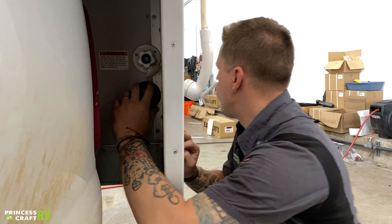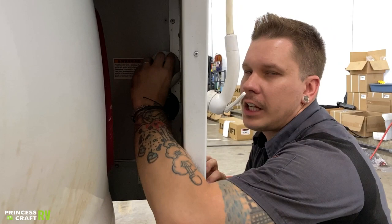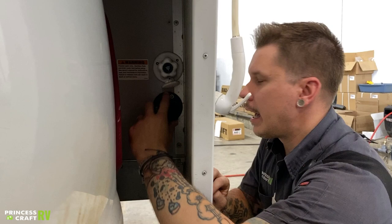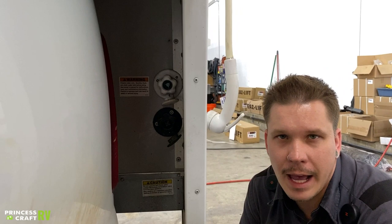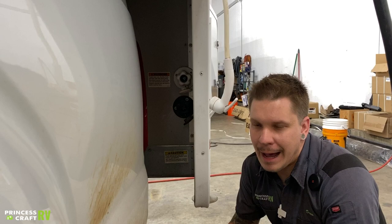Any water pressure regulator should hook directly onto the spigot side, as close to the water source as you can. Your hose connects onto that and then makes this transition onto the trailer-bound connection by rotating that trailer connection. Down below that we have a black tank flush, which corresponds with a jet inside the black water tank specifically designed to help blast off compounded toilet waste.